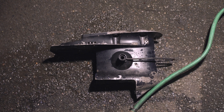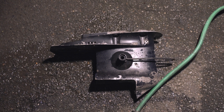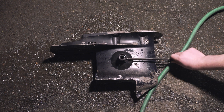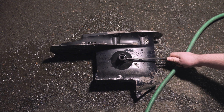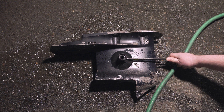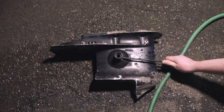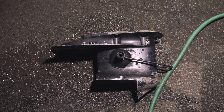The second way you can screw up your motor — and this has definitely happened to me — is that vibration can cause the muffs to move slightly. When I had another motor and ran it on full speed for a moment with the choke up, then slowed it down again, the vibration would cause the muffs to very slightly fall off. The danger is that you turn on the motor, it's running, and you see water coming out of the little nozzle, meaning it's getting cooling. Everything seems perfect.